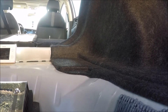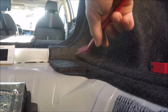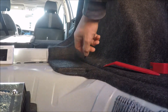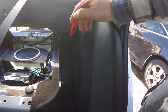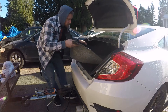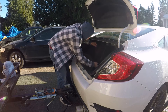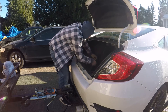The last clip on both sides is right here. And almost forgot — inside the car right here there's another clip. You can fish these out — you pretty much just grab the bottom, rotate it, bring the bottom of it inside and up, and it'll clear up in the front.